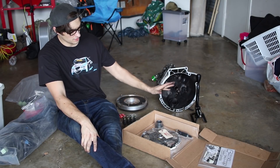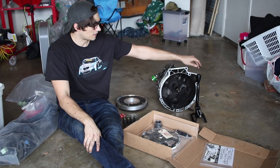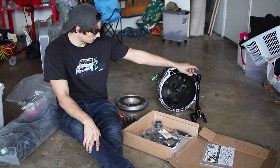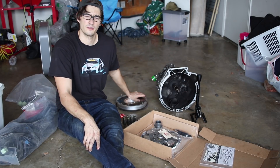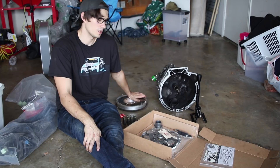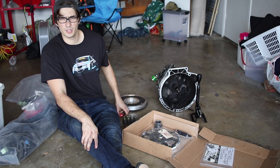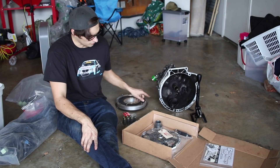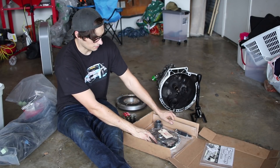Today we're talking about transmission stuff. I've got a brand new clutch from Clutch Masters, my racing shifter from Individual Racing Parts — a very cool chassis-mounted shifter. I have my old flywheel pulled off the parts S52, the ZF swapped from the S52, some new hardware and bearings to put on the new clutch with the old flywheel. But let's dig into each of the parts.